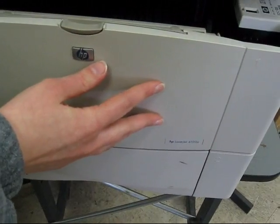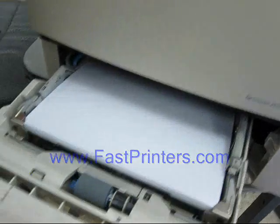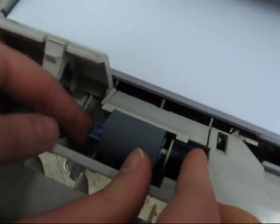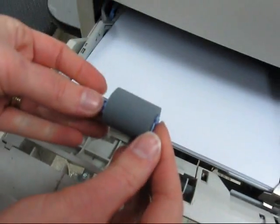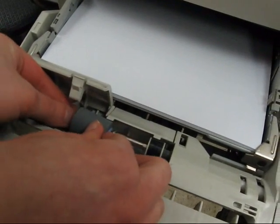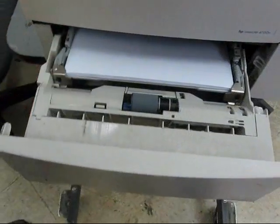Re-install your envelope cover. Pull out your paper tray — not all the way. There's a small door; flip it open and pinch the end of the feed roller in the tray — it'll slide off the shaft. Slide in your new feed roller and close the door.